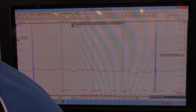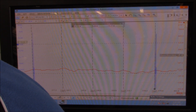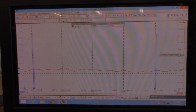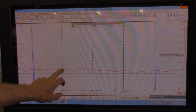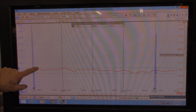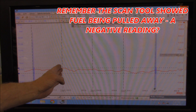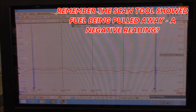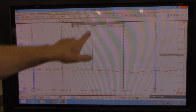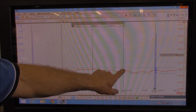If I bring one of the rulers down, you can see it's quite low there compared to high up the top. So if that means something — honestly, I don't know. It does tend to drop away. This is our fourth one, of course. Just keep in mind that this is when the injector is activated, so it's opened. We're getting a higher point up here, and then the other injectors would take place here, here, and here. But there certainly seems to be a higher return here, a higher pressure, in comparison to the other ones as they slowly go back down.